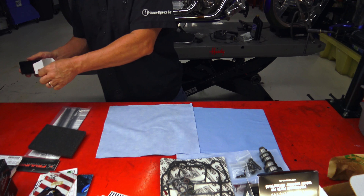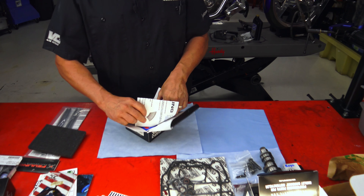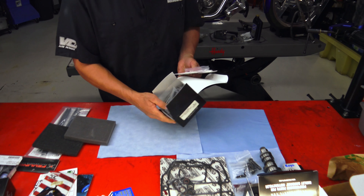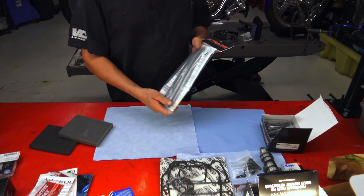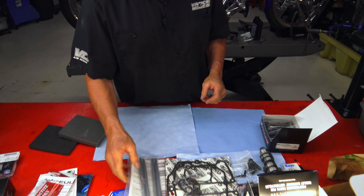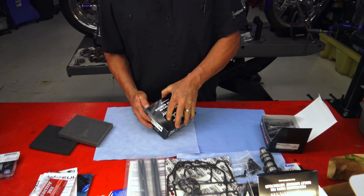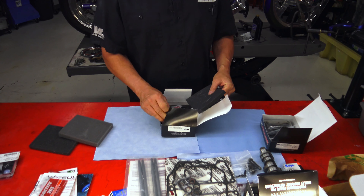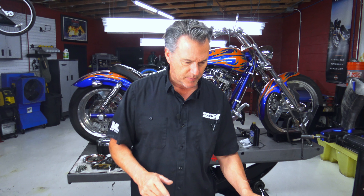There's more instructions, and — oh look at this — a pocket constitution. Great American company, you gotta love that. There should be a cam bearing in here too. Yes — cam bearing. I'm also going to be using the one-piece rods. As anybody who watches my channel knows, I like one-piece rods. I don't like the adjustables — they tend to come loose and flex. And of course we're going to run the Feuling breathers for the M8s. Really like these, great product. The gaskets that come in the kit are the Cometics — we'll use those.